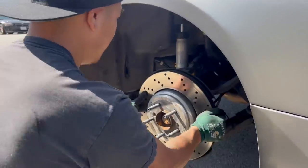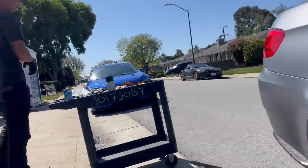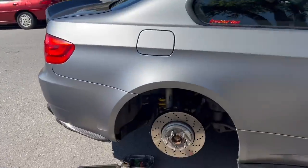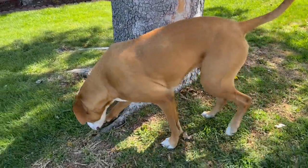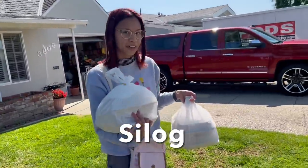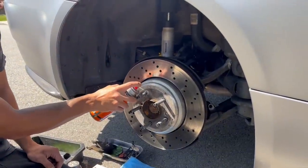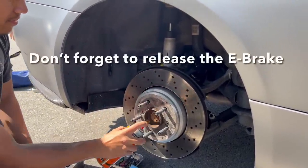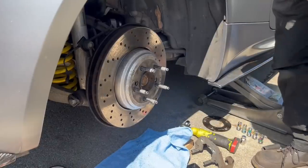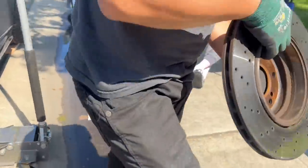It's pretty loose, so that's good. The rear rotors are probably rusted on, so you can either hammer it out or use Brandon's magic spray. You spray it in the little holes right here. What makes this different from PB Blaster? Different formula, I guess. And that was it — one tap. That's a lot easier. It's that spray. Also, Penelope, Ellie, and Inanitsimeo brought some Filipino breakfast.